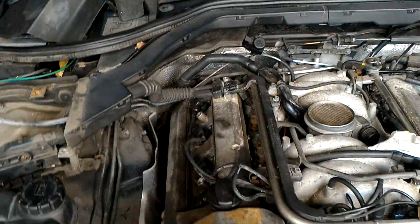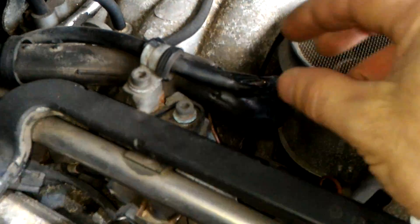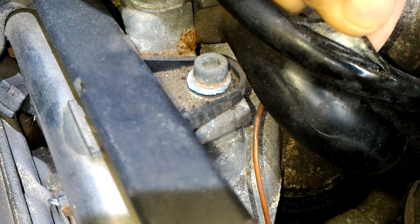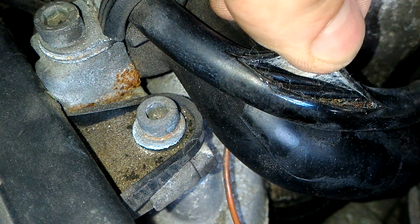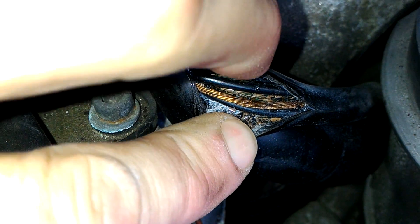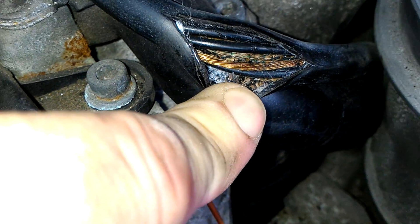This is the affected throttle body unit — the one with bad insulation on its wires. The customer had already tried to cut the insulation here. What you might see is black wires, so you might think the unit is good. But in reality those are not wires — those are just pieces of plastic strain to keep the loom rigid. The actual wires are underneath, and as you can see all of the wires are completely deteriorated.